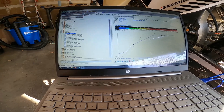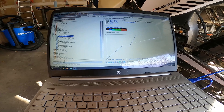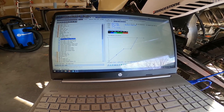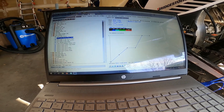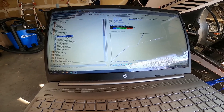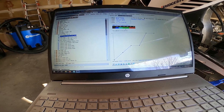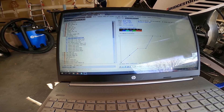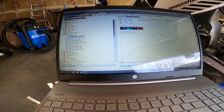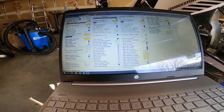I'm going to try a few different things, but one thing I don't like is the setting for the AFR crank altitude compensation. You can see here at 95 to 105 there's no compensation; at 85 and 75 it's minus 0.5. The way I take that is a negative 0.5 AFR. At 70 to 85 — which is a higher elevation — I'm at about 80.8 for my barometric pressure.